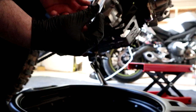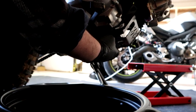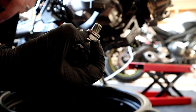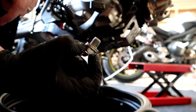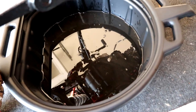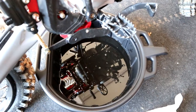When you open this, oil is going to come out. If you have a pair of gloves like these — I got a hundred of them for like a few bucks — use them. There's the oil. Make sure to keep the screw and the washer, don't lose them. A few paper towels are going to come in handy. Once it's about finished draining, make sure to move the bike from side to side while it's standing up, not just in one position.